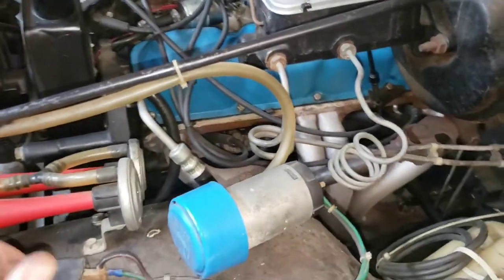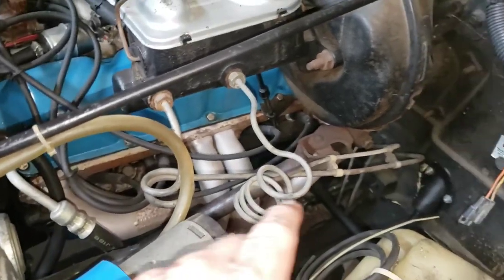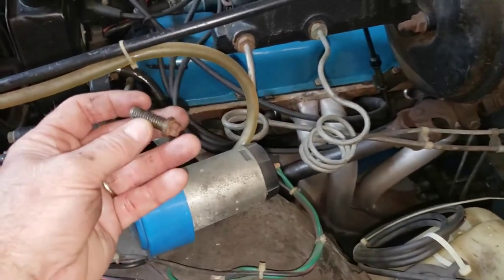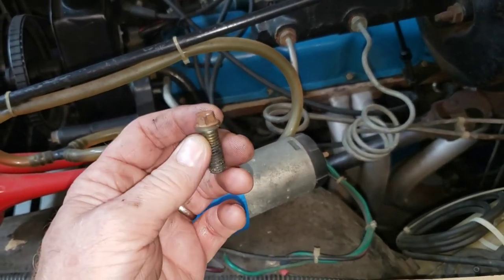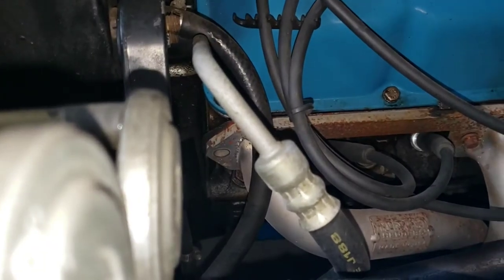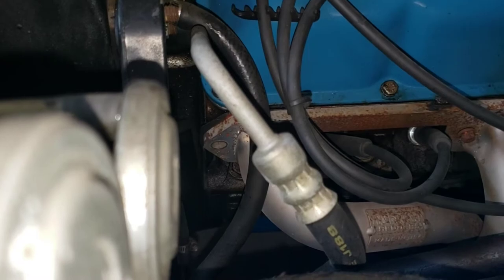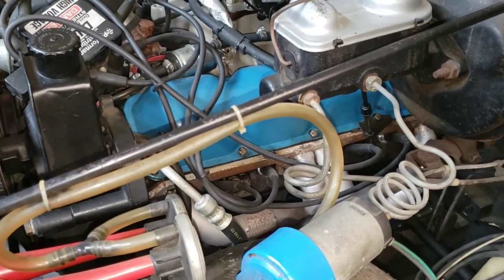Alright folks, you guys are not going to believe what I found on the floor when I put this Jeep back down. I forgot to loosen the collector-to-exhaust-pipe flange — I said I was going to do it but I forgot. But when I lowered the Jeep back down, I saw this on the floor. I picked it up and instantly realized what it is — that's a header bolt. It fell out when I put the Jeep in the air. I looked back there — we got two in the middle, and look at that right there, we're missing a bolt. The stupid thing worked its way out. I'm going to go for the easy fix and hope that if I reinstall this bolt and tighten up the rest, our problems go away. Let's give that a try first and see what happens — let's see if we get lucky.